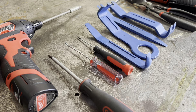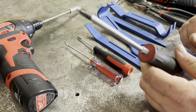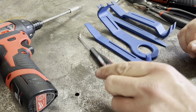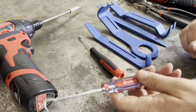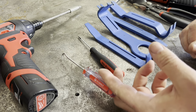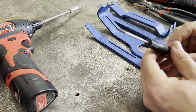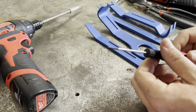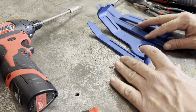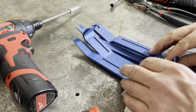The wiring for the mirror hides up underneath the door panel also. What we'll need: a number two Phillips head screwdriver, a pick is helpful for getting some of the wire connectors loose and popping off some of the trim caps to access the screws for the door panel. A small flat blade to use as a pry tool. A set of trim tools — plastic pry bars. Harbor Freight sells these cheap.